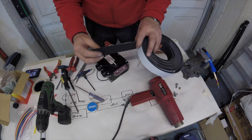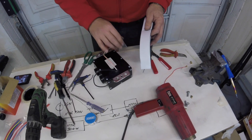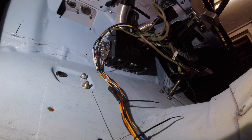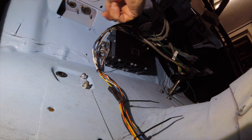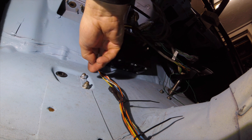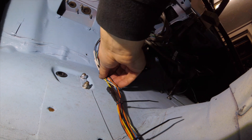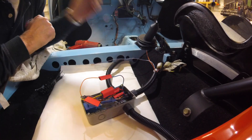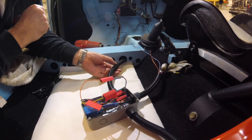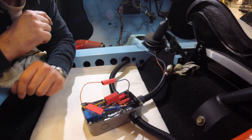One final touch is to put a couple of strips of foam packing in here just to stop any vibration between the heater and the bulkhead. I've now fitted the heater and just extended these cables here — these are extensions for the light switch and the rear fog light. And then this cable, the one you've seen me fit to the heater, is the power cable to supply the heater. I've just formed that into a loom. The new cable comes through this bit of Copex here — this is just flexible building trunking, most DIY places sell it in big rolls.